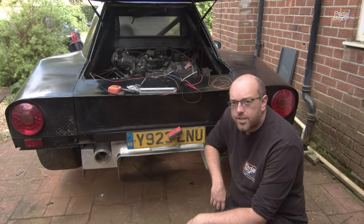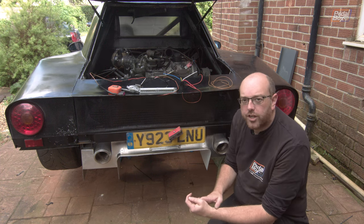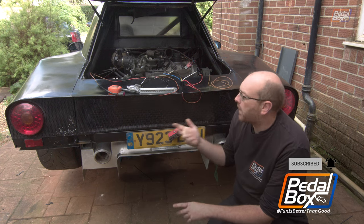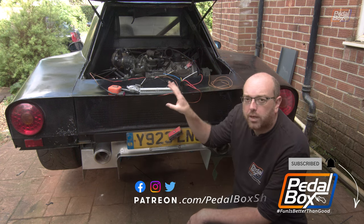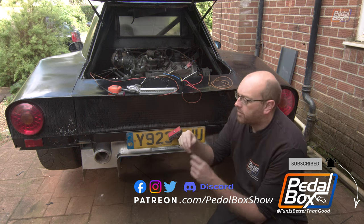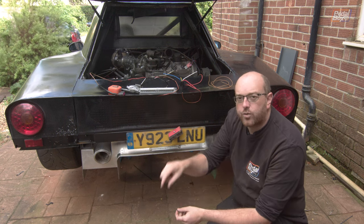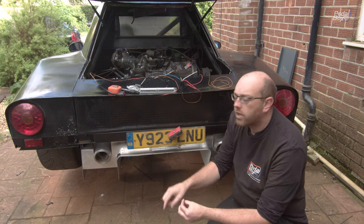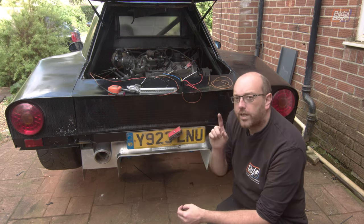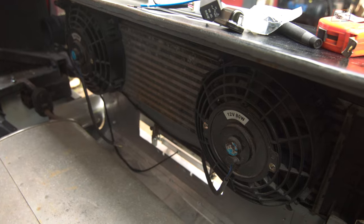The wiring for these fans is fairly simple — we just need to run them in parallel, deliver power, and then have some way to turn them on, hopefully automatically when the ignition goes on. For power we're taking it off the original battery plate which has a bunch of blade fuses across the top of the battery, and there are also three individual cartridge fuses that we can use, which are all 30 amps at the moment — a little bit overkill, but we can put some smaller ones in which are more reasonable to run these two 80-watt fans.